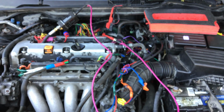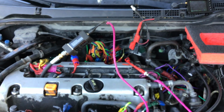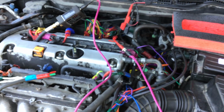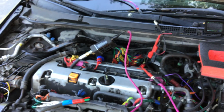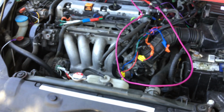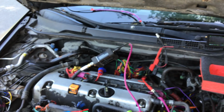we're dealing with misfire and we do our diagnosis, we determine something from relative compression, or from our vacuum waveform, or from our tailpipe cranking waveform, one of our waveforms, that we do have an engine mechanical problem, and there's a possibility that we may have leakage past an intake or an exhaust valve. So what I'm going to do here is use two transducers in unison together.